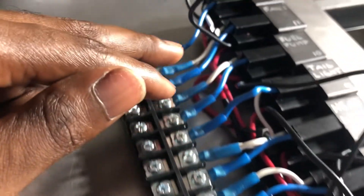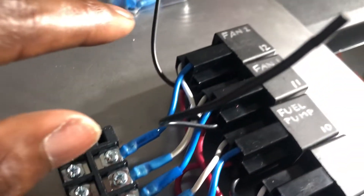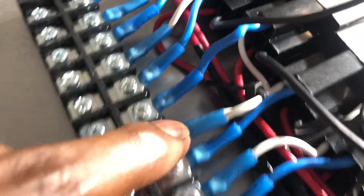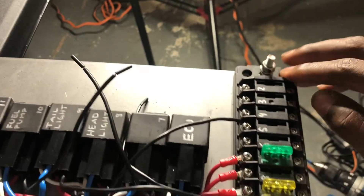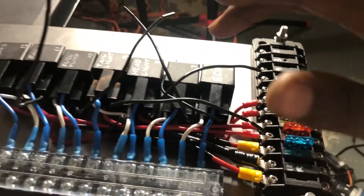The only thing we've got to do now is put everything up and heat shrink. These are our negatives — we don't need those right now. You can see how I decided to run the wires: powers go under everything into their relays, then to the load and from the switch, in a pattern. Certain ones like the fans have two relays with one switch, and the tail light and headlight are also two relays with one switch. The layout goes: load, switch, load, switch, load, two switches, load, load, switch, load, two switches, load.